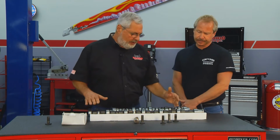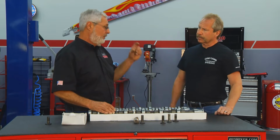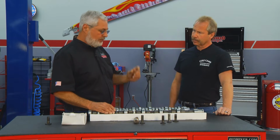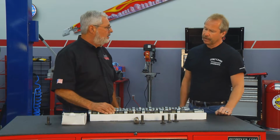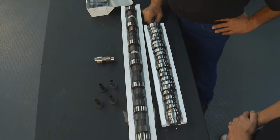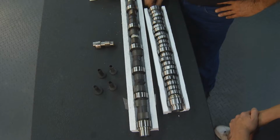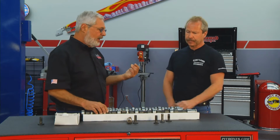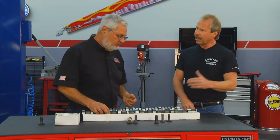Now also, when you start doing performance work, if you don't have an EGT, you need to have one, because the exhaust gas temperature starts to go through the roof. By getting the air out, can you actually control that? Huge, yeah. Getting fresh air in and getting it out, you're helping spool the turbo quicker. You spool the turbo quicker, you get a little bit better bottom end, and you can drop your EGTs, what, a couple hundred degrees? Find that sometimes a minimum. We've even seen higher.